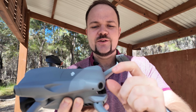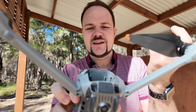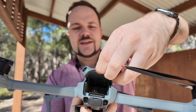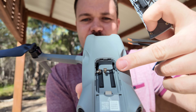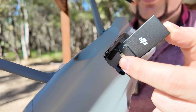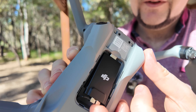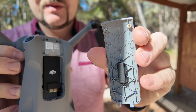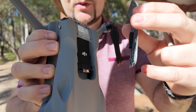As I showed you in the initial video, all you've got to do is remove the battery from the Air 3. You then loosen the two screws under here — it comes with an included screwdriver when you get the cellular dongle — and then you basically just pull off this back piece once it's loosened. There we go, and that exposes the location where you can put in the cellular dongle. The next step is to connect up the two antennas to the actual dongle itself, and then there's a little bit of give so you can push the antennas into the body of the unit. You just want to line it up with the USB-C, push it into place, and it literally just sits perfectly in the body of the Air 3. When you put the plastic panel back on, there's actually this little sponge-like material that pushes down the dongle to make sure it's a nice snug fit.